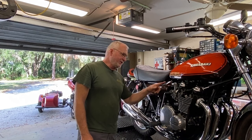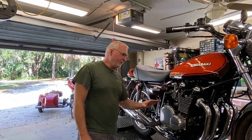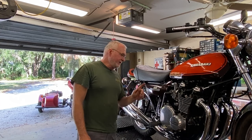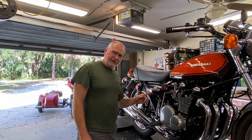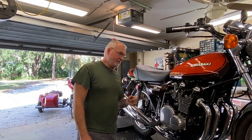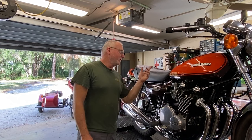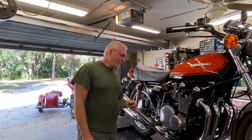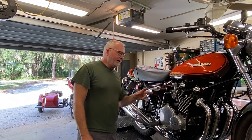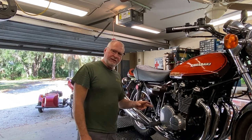I think we're going to leave the jetting for now. The next step is a test ride — give it a little bit of a spirited thrashing up and down the road. We're out in the country. If I need to do any adjustments on the jetting, we'll do them based on what I feel on that. I don't think we're going to have to, because this thing is definitely running a little bit on the rich side, which is where the literature from the exhaust from Z1Parts.net suggests it should be.